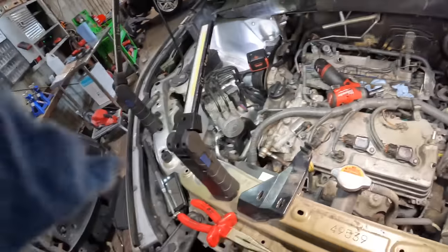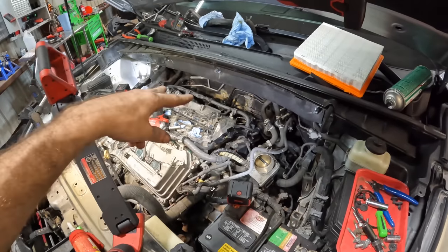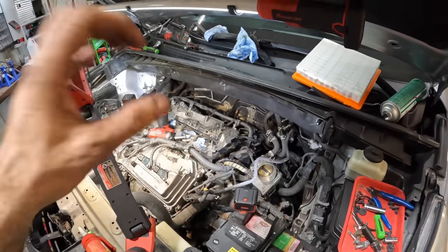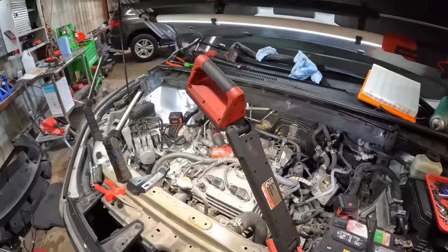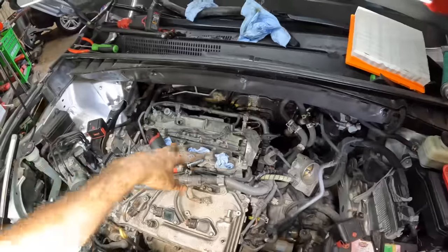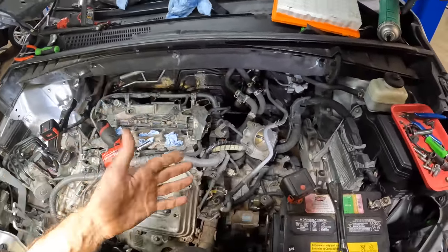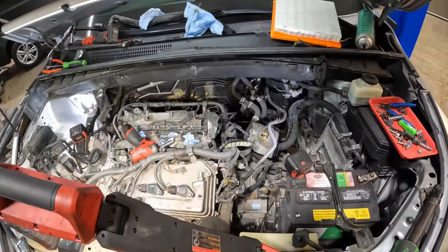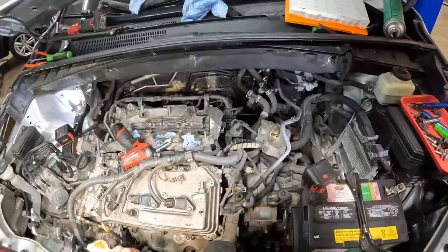Good. All right, folks, here's the dealio. It is 4:50 p.m. in the afternoon, and I still do not have any coils. So I guess what I'm gonna have to do is just save the rest of this for a part two video. The coils should be here sometime in the morning, maybe late afternoon. Once those coils show up, I can drop them in on the backside. We can re-gasket the lower and upper intake manifold, get that bolted on, get the PCV system, the EVAP system, the throttle body, all that good stuff reconnected. In the meantime, I guess I can go ahead and spill and fill the oil. You guys don't want to see that, so I'm going to skip that part.